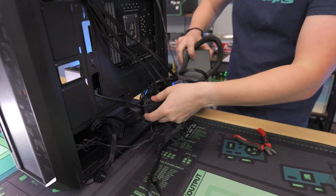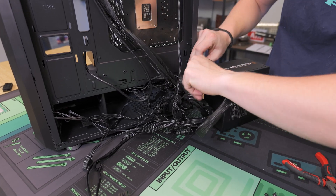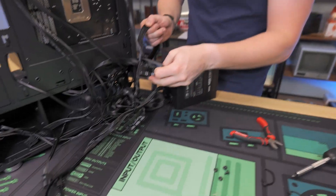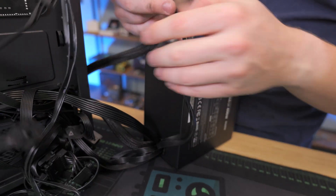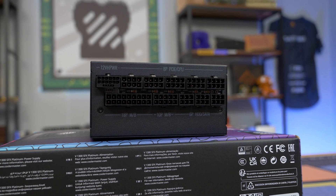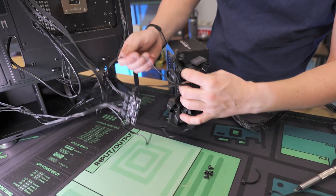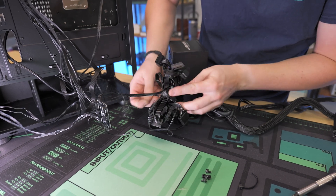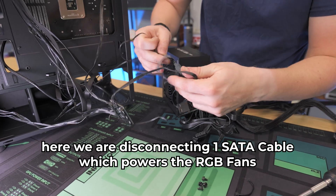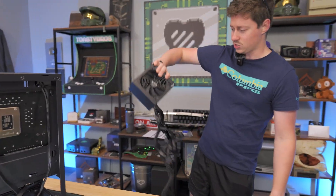This part's going to be a little tedious — there are a lot of cables in here. Now if you don't have a modular power supply — this is a non-modular power supply — that means all the connectors come from this spot and you can't remove them. A modular power supply has cables you can actually connect and disconnect, which is nice. In our case we have a lot of extra cables that we bunched together. We do have to unplug a couple things — looks like we have SATA to power our fans. In our case it is a SATA connector. We got to disconnect that, and now the power supply is totally out.